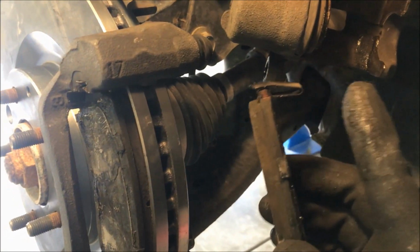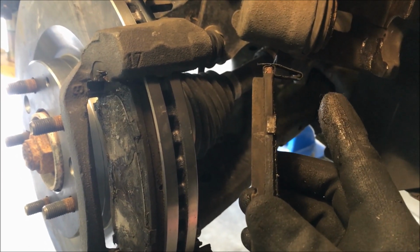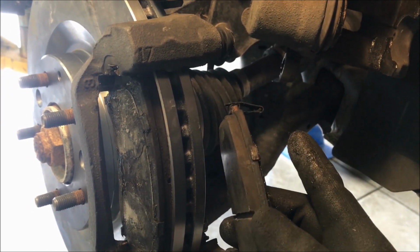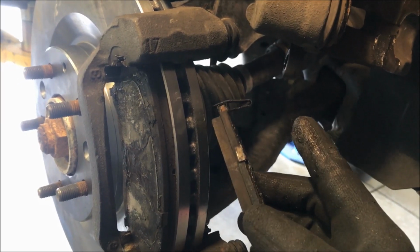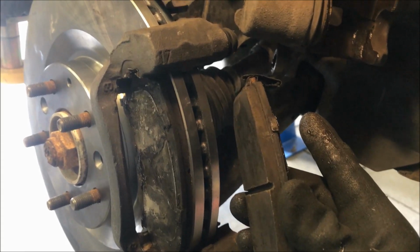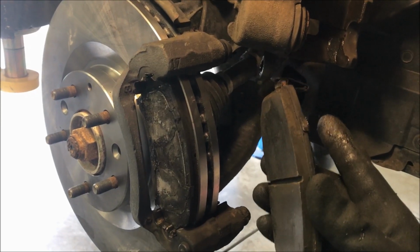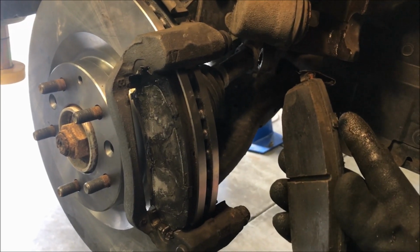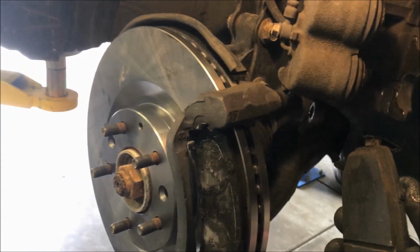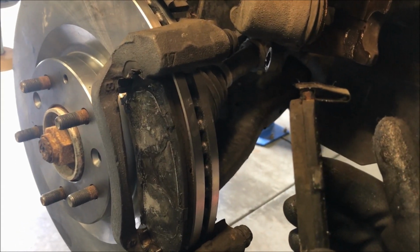Before I put that in there, I'll show you the squeaker. When your brakes actually do wear out all the way, then that's going to touch on this rotor. When that pad has worn down far enough, it'll start squeaking on there. So if you've worn them down to where they're done, you'll hear a different kind of screeching. This one was just a minor squeak, just in reverse. So just the way the pads were kind of riding in there, and so we're re-greasing them to put it back together, and like I said, just replacing the rotor. But yeah, that's the actual wear indicator there.